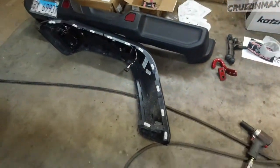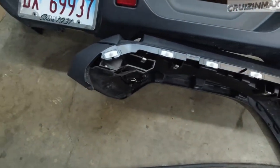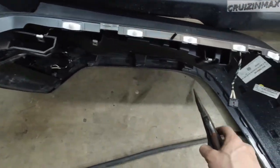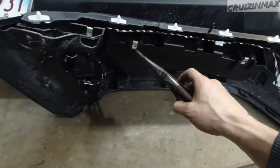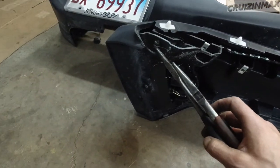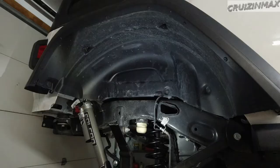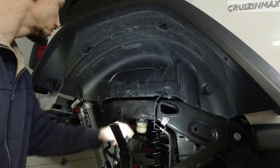Let's take a closer look — all these little holes here, that's where all the clips are. There's a 10 here, another here, and these two you remove with the fender liner, then one here and one here. This is naked Jeep right here. On the rear, I'm going to remove the fender liner — looks like just a bunch of push pins.